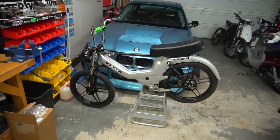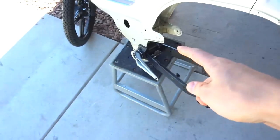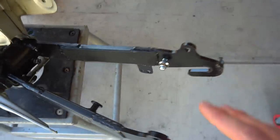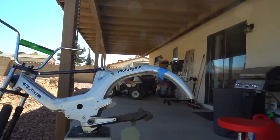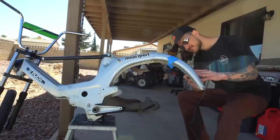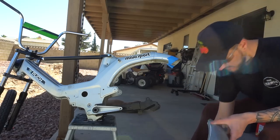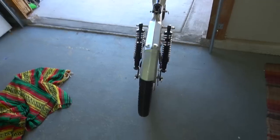The angle on the new headlight is a lot better slammed down. We might need to make a bracket to bolt it into the actual fender. Back wheel is off because we're cutting the fender — I also finished mounting the swing arm and drilled the bracket needed for the rear caliper mount. Got it lined up where I want to cut, going to play it safe and make the first cut. Fender's chopped — buttery smooth back there after using a grinding wheel on the Dremel. Nearly a perfect cut.